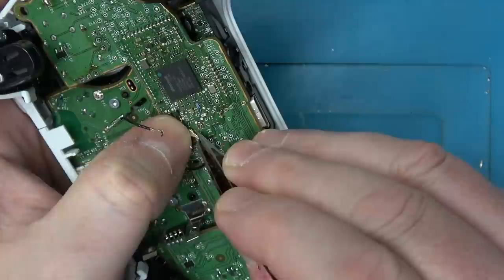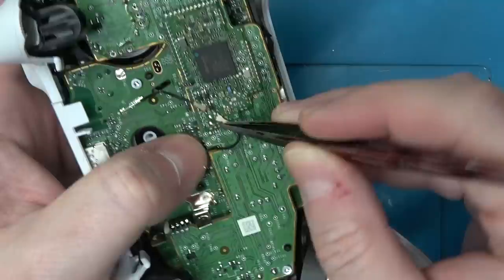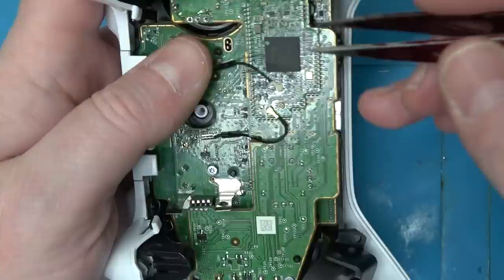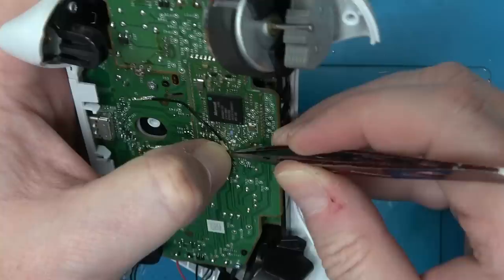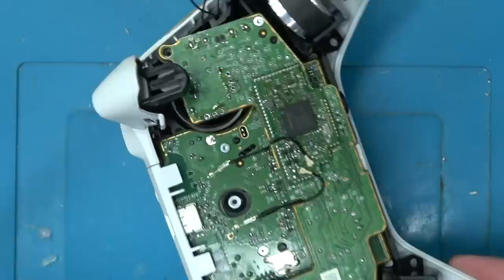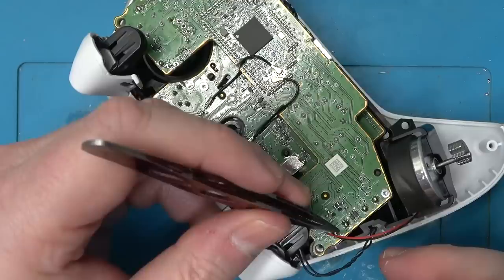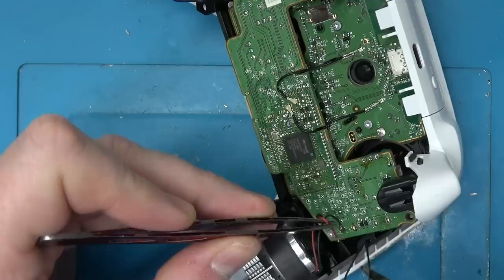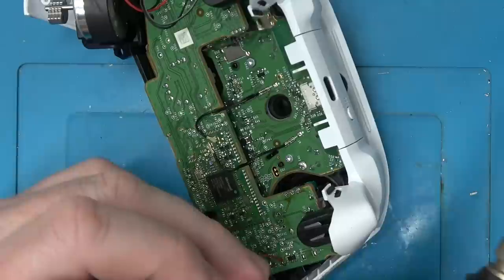Someone might say the Dreamcast had Hall Effect sensors — for the analog triggers and for the joystick. This Xbox controller already uses two Hall Effect sensors for the analog triggers. If you wanted to use Hall Effect for the joysticks, you'd need maybe three per joystick — but that's three more chips in this modern age. Maybe they could move back to a rotary encoder like the N64 had. That's why the N64 analog stick always still worked no matter how worn — it was an optical sensor sensing relative movement, kind of like the mouse wheel on your mouse.